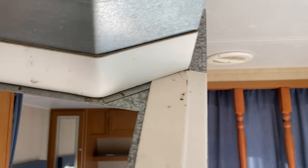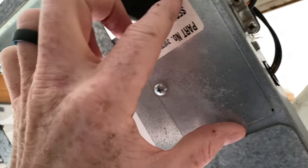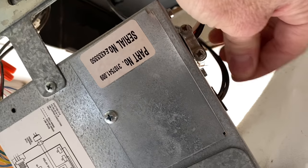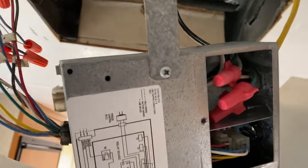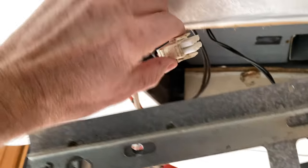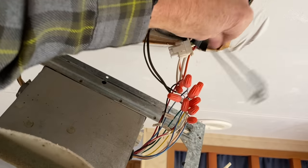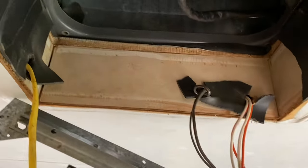You can see up in here the four bolts and our wiring. This piece right here just comes undone. I'm going to take this little cover plate off and see if I can disconnect these wires — this is the only one I need to disconnect. I just undid one screw, pulled this little cover plate off, and you can see where the wires come in. There's a little clip on the inside, and once we undo that it's going to free us from the top unit. We've got both connections disconnected now, so everything else should be good to go.